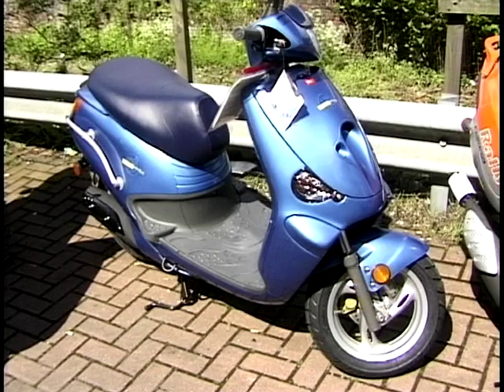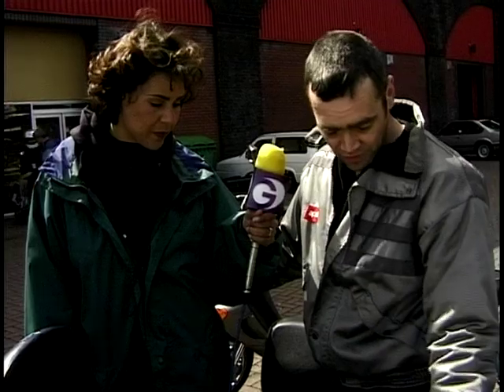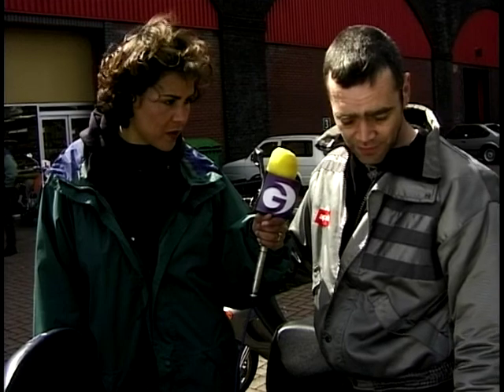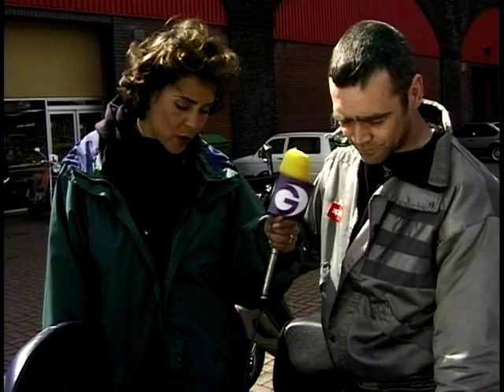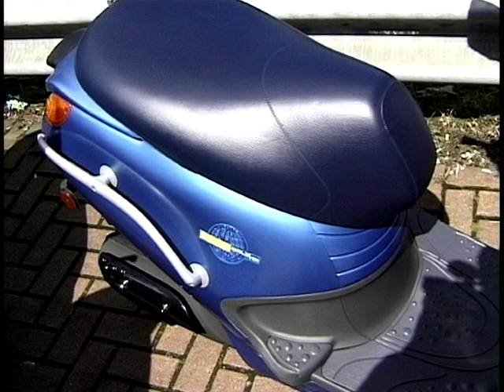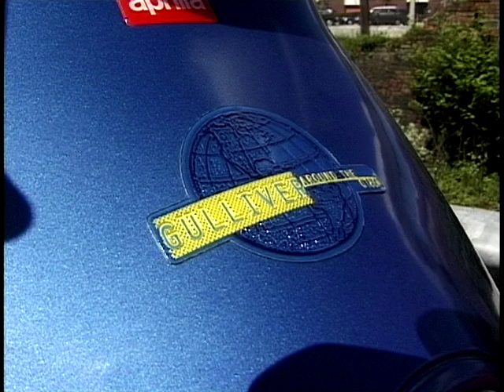Can you tell me a little bit about the engine? Again, it's a little air-cooled two-stroke — you'd have to put two-stroke oil in to lubricate the engine all the time. Other than that, it's dead low-maintenance. Is it low-maintenance? Yeah, they even come with a three-year warranty. How often do I have to bring it in for an overhaul? Once every 3,000 miles or a year. But if you think about it, it's only designed for short journeys, so that is quite a long time between service intervals.